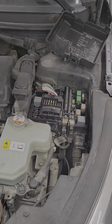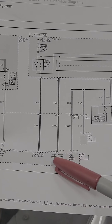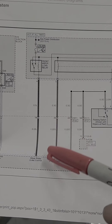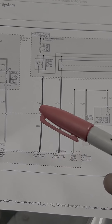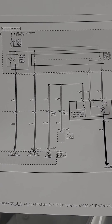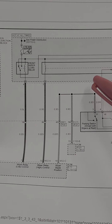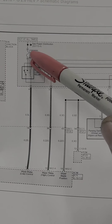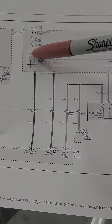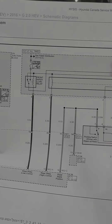I have the schematic now. As you can see, there's our wiper control for the relays — that's what we're registering to in our data when we turn it on. I want to divide the system to see if we have a ground issue or a relay sticking problem. I'm going to remove this 30-amp fuse to check if we have a short power issue that might just be turning it on.